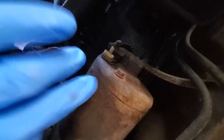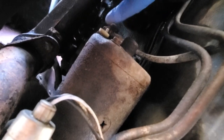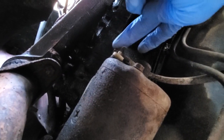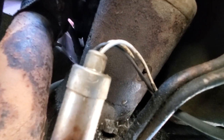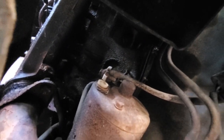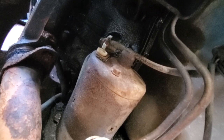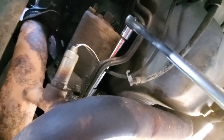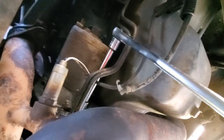The first thing we need to do is disconnect the wiring right here, which is held in place by a bolt. I believe that is a 3/8 bolt. I'm going to go ahead and remove that, and then there are two bolts that actually hold the starter in place and we will remove those next. You can see I've gotten the wire removed from up here — I just pulled it down out of the way. Now we are ready to move on to removing the two mounting bolts.